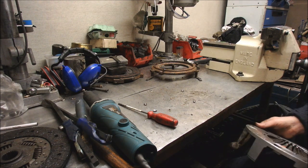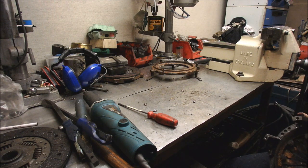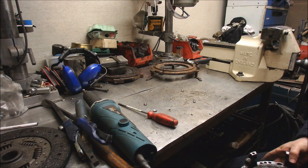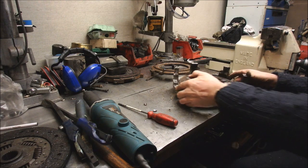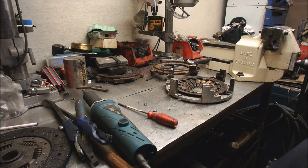Let's try drilling from the other side, one of the ones I've already drilled. So let's try the short one. Let's try drilling that one there. I'll grind it down to the surface, then spot punch it, and give it a damn good drilling. See what that does.